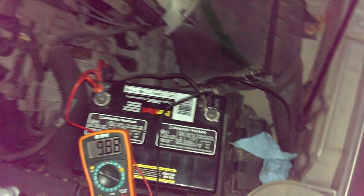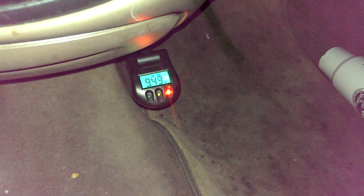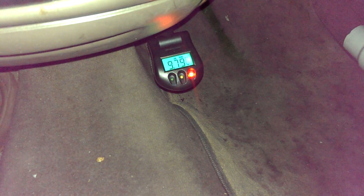I'm going to try to start that. I've got my meter in here also. There's a little bit of a difference in the voltage — the voltage drop. Turn the interior light on. Usually the voltage is pretty close though. I measured it earlier at 10.06 at the battery, and then here it was 10.02, so it's a .04 difference usually. There you see it kick back up after that.